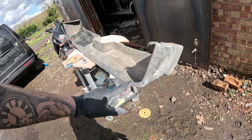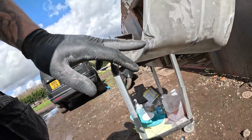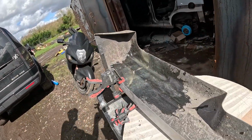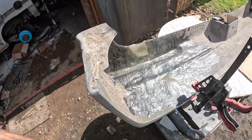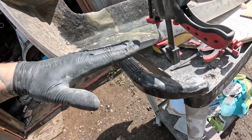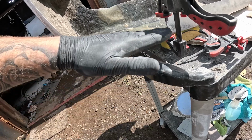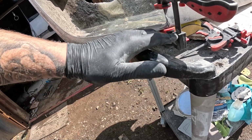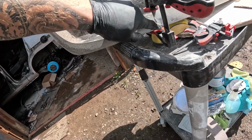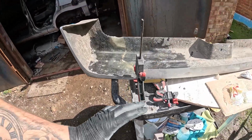So we brought the rear lip extension thing outside, and as you can see, all of these are quite badly damaged. The repair on this has turned out really well. I'm quite happy with it, but it's just slightly kicking out here, so this part of the bumper is doing this a little bit from there, it's pivoting down. So I've just got the clamp there in place, and I'm going to reinforce it with some fiberglass filler behind there and here as well, and that should correct it.